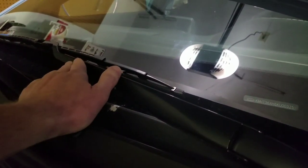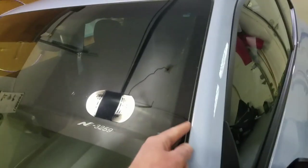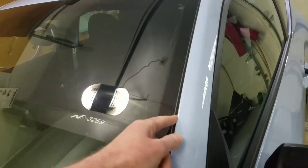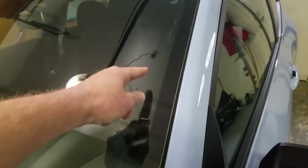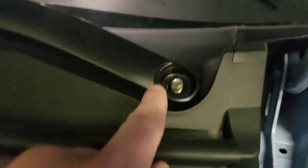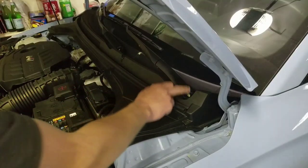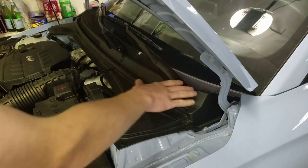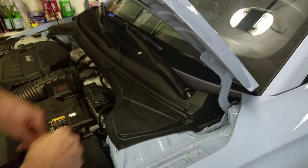If you turn on your windshield wipers and it goes up, you don't want it hitting right here on your A-pillar. And you can see the line where it stops. So if you get worried about it, honestly you can do this step to make sure that you get this in the right position. So we got the nut off, we got it marked both ways - marked here and up there with tape. No way we're gonna mess up this alignment.